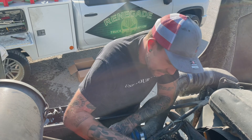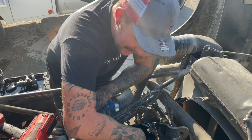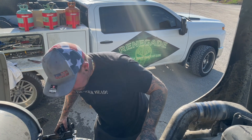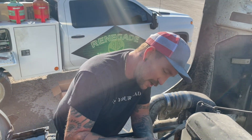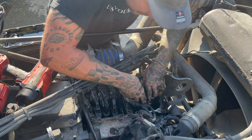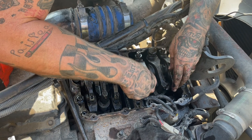I want to point out — make sure that you check your push rods and make sure they're still in the cup. Because if they aren't in the cup when you start this thing up, it's going to bend them and you're going to cause some damage. I've literally seen these things start up and the push rod itself go through the side of the block — these things can get violent. So be very careful with that. Check your dowel pin, roll your sleeve over until it sits down in.